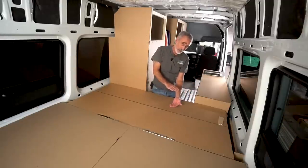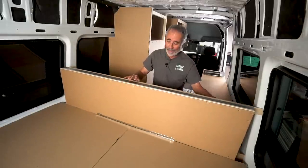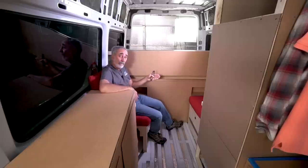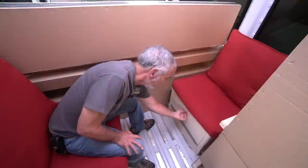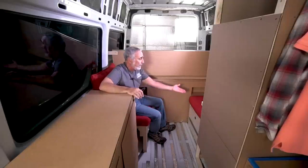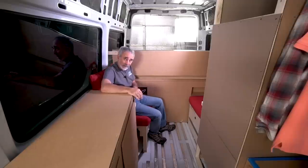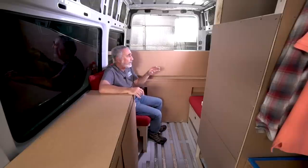The bed platform is about eight inches, the mattress about eight inches — so 16 inches total height. In the morning you bring the platform back up, put your cushions up, and you're ready for breakfast. This is the first time I've built seat boxes over the fenders and wheel wells — only over the rear half of the wheel well, since the front half is behind the bulkhead. The seat boxes have shoe storage in front, and when you lift the seat bottom you have easy access to mechanicals — for instance the water pump and zone valves.